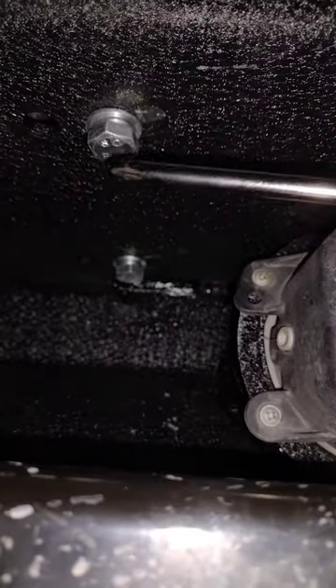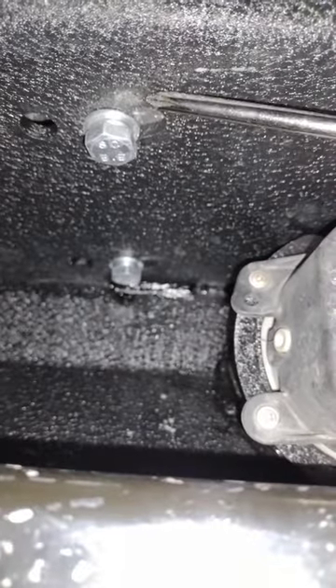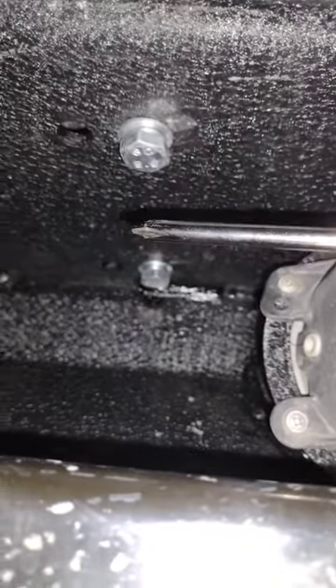There are four feet on the winch. At the bottom of each foot you have these rectangular openings. You've got four square nuts and four bolts. You're going to push each square nut into the rectangular opening of each foot. Then you're going to set the winch down slowly on top. We are underneath and behind the bumper so I can show you the mounting points for the winch. At the bottom of each foot there was that square nut, and all you have to do is fish the bolt up through the nut and start tightening it — it will catch the nut, and because the nut is square it won't turn, which will allow you to screw the bolt up into the winch.